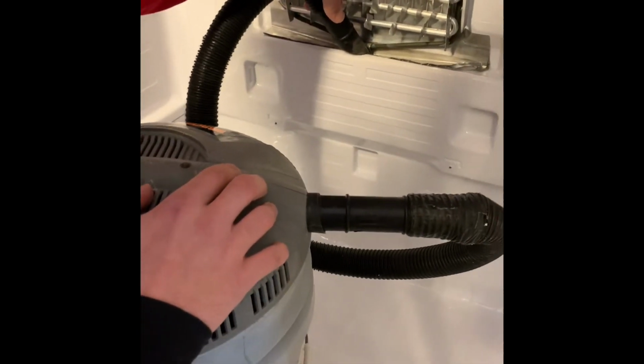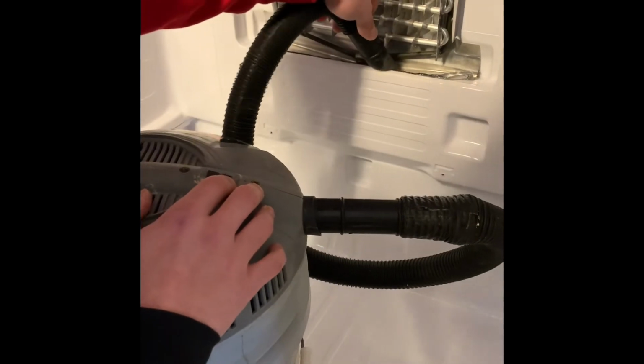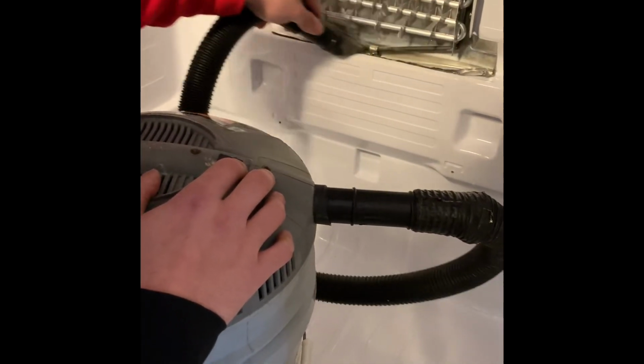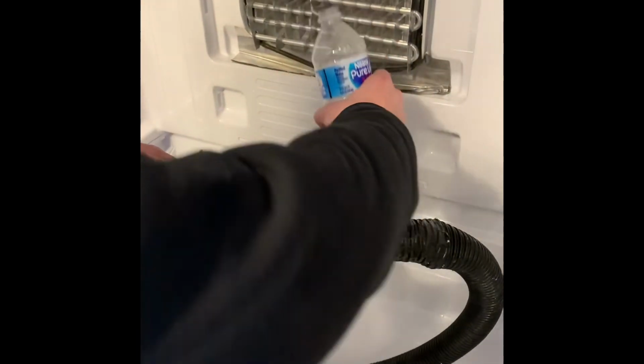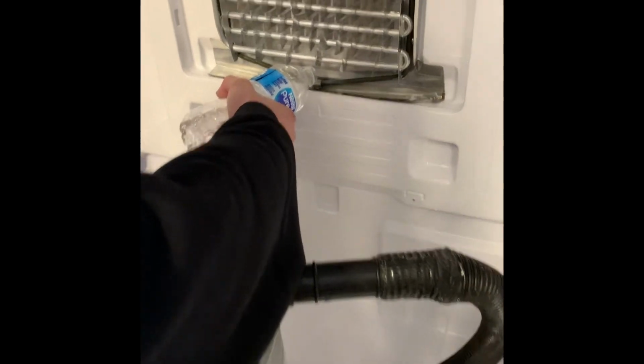So you're going to want to shop vac the water out. Get a cup of really, really hot water and just keep dumping it down the drain and shop vacuuming it out. This could take up to 30 minutes. Sometimes just be really, really patient with it. Once you get down the road, it will free up and then that water will rush down that drain, and let it sit for a minute. Make sure that it's completely clear so you don't have this problem again.